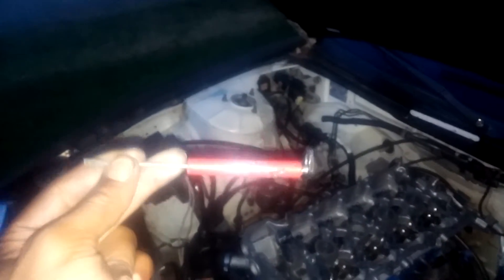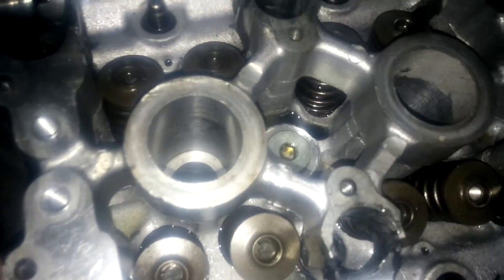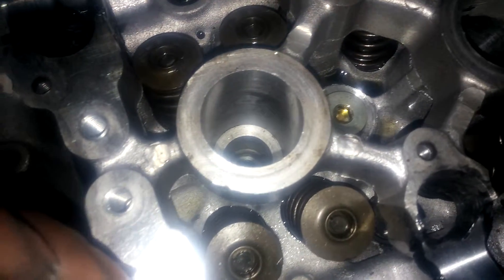We're back. Just to save some time because I'm running out of daylight — I've already done a few of them but left one off just to give you an example. It's pretty straightforward. I have a little screwdriver-slash-magnet tool. What you want to do is coat your ARP washers with ARP grease and then slip it over the stud — pretty easy, nothing hard about that. After that, take your ARP nut, grease the bottom of it with the ARP grease, and drop it on.